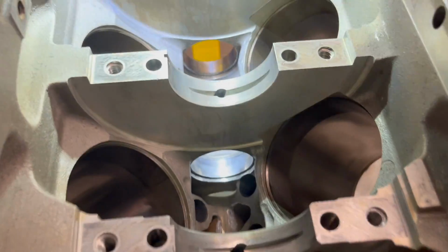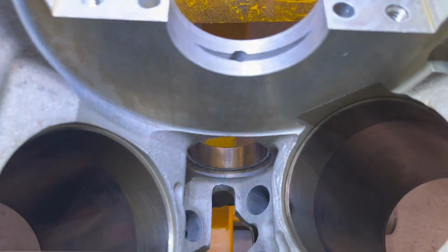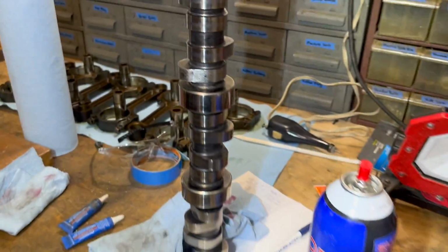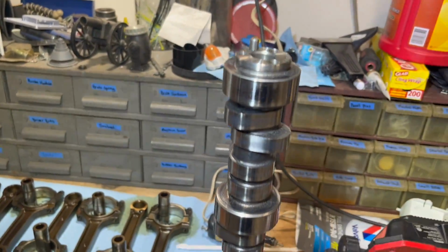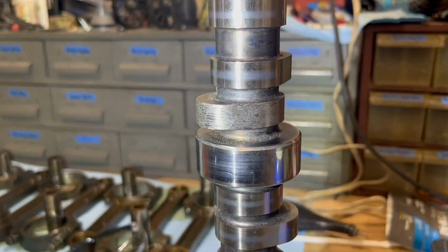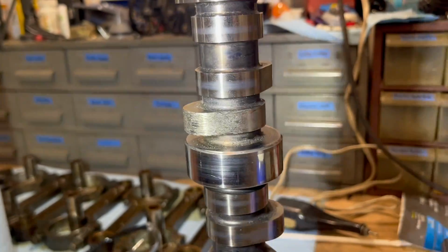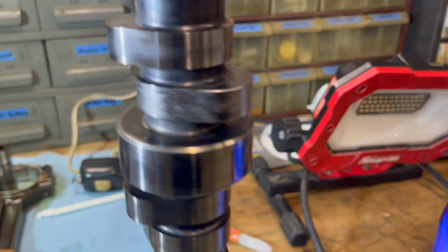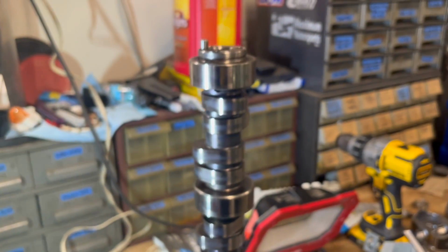You know, this definitely was my first time. That's for sure. So probably tomorrow what I'll do is I'll clean this extra cam that I have. This is a TSP 228 cam with a busted lobe. Yeah, it had a lifter turn and ate that one. Could it be fixed? Yeah, probably. That's why I never threw it away, but it's not going in any of my motors that I want. So I'll clean this up because it's got a bunch of dust and stuff on it, and I'll throw that in there to see what it feels like.